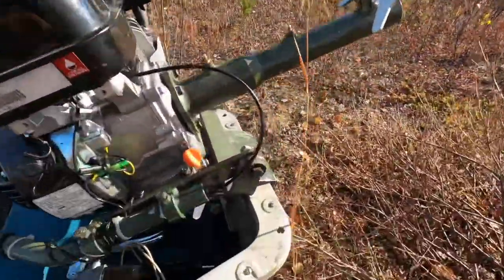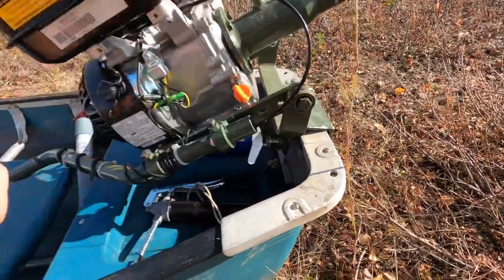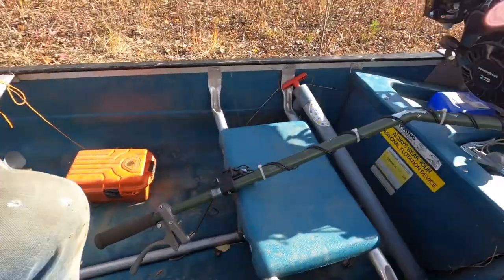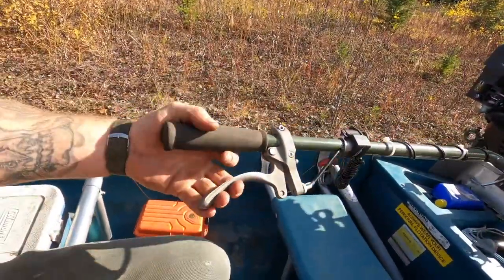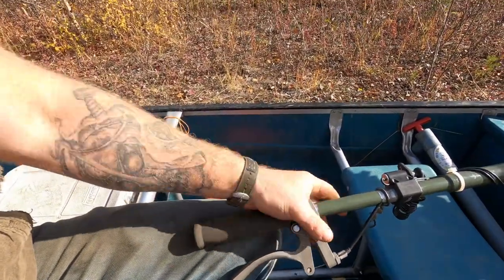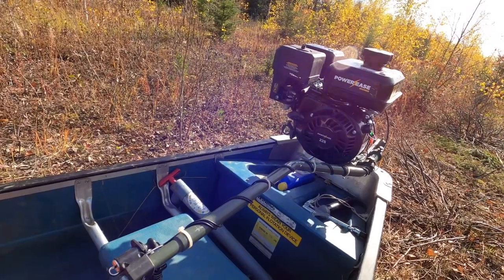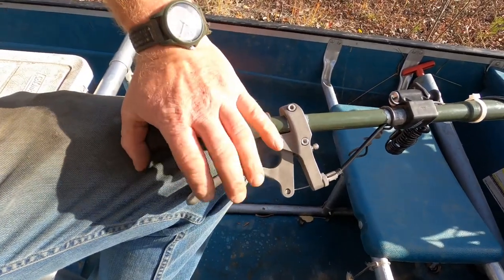Another thing — this is the balance point. If you're at full throttle and having to lift up on the handle to push it down, Temple said to move the balance point back. I didn't have problems since I was just puttering at idle — this thing will push the canoe right upriver. The throttle mechanism is pretty simple, just a brake lever. You can spin it around and it goes into the handle right here, so don't yard on it too much. You can adjust the throttle travel — if it's wide open you've got to really open your hand, so I adjusted mine to be a little tighter.